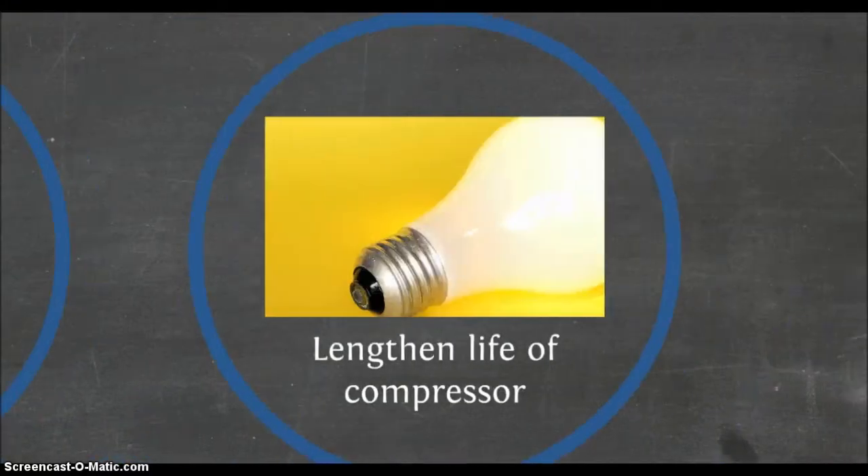For most biomolecules and many microbial cultures, negative 70 degrees Celsius is adequate for months to a few years. Raising the freezer temperature can lengthen the life of the freezer's compressor, reducing the frequency of freezer purchases, and save energy.